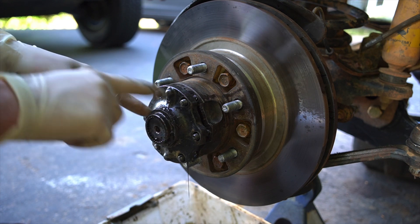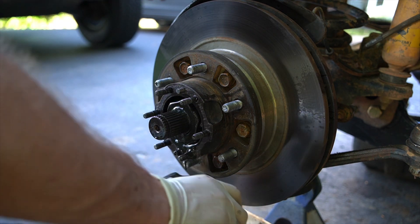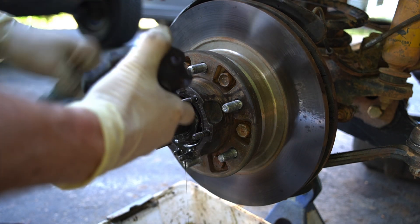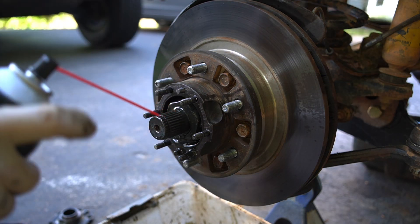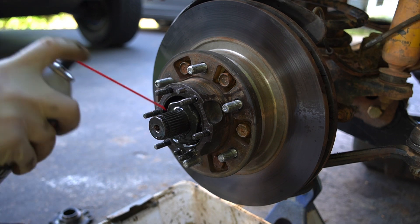If your flange won't come off, double check that you pulled that snap ring off. I like to keep a plastic bucket below this because it just starts to drip and cause a real big mess. Go ahead and set your flange off to the side as we're going to be reusing that. Next we're going to work on getting our preload nuts off — that's how you preload the wheel bearings, which we'll get into near the end of the video.